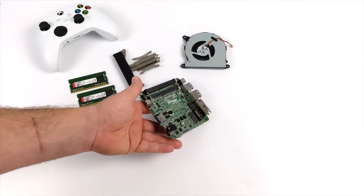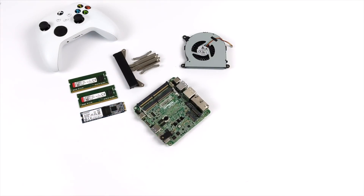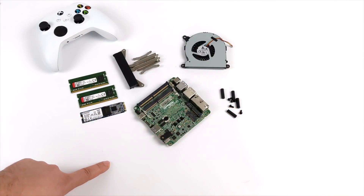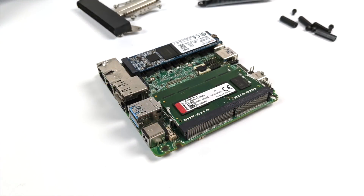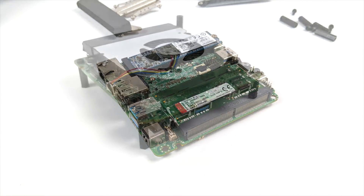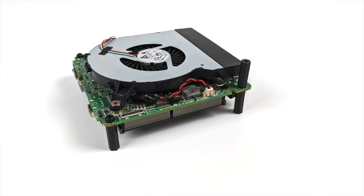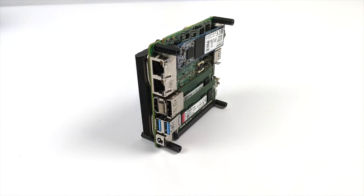When this 1135G7 is running in different laptops it's usually set around 15 to 20 watts — sometimes 18 — but with this board we can actually go into the BIOS and take it all the way up to 35 watts, which really unlocks the performance. Once I get it all put together it looks something like this. I also had some plastic standoffs laying around to keep it up off the table, and it's putting out some good power for its size.